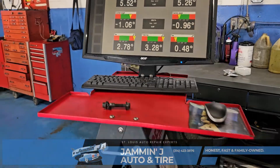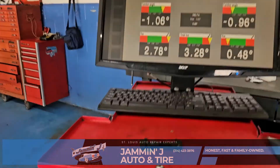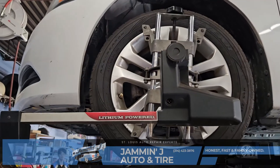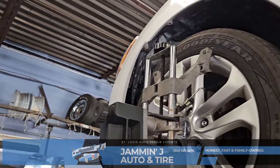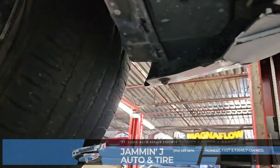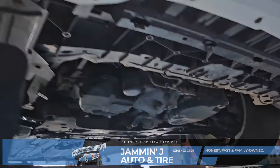We're going to swing back here and show you this alignment machine. There are much fancier ones out there — this one requires you to actually understand what caster, camber, and toe are; some of the others do a lot of that for you. This one is actually Bluetooth. It picks up on Bluetooth, and on each wheel we have an alignment head. What this does is draw an electronic rectangle around the car. There's a camera up here going back to the rear sensor, and another camera at the front shooting across to the other side, so we've drawn a rectangle with four sensors around the vehicle.